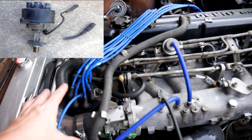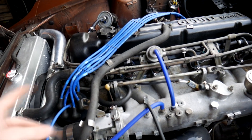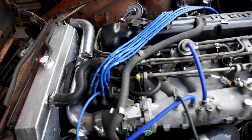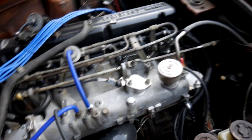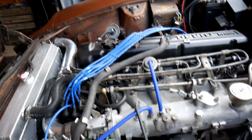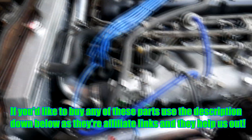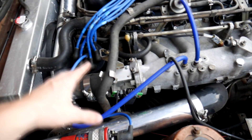The main things you're going to need: you have to have a turbo ZX distributor — a distributor that has a CAS installed on it — because the timing is actually kept on that. So you have to make sure you get a 280ZX turbo distributor. My L28ET is mostly stock; I'm running about 10 PSI of boost with a cheap manual boost controller that basically just tells the wastegate when to open. It's also intercooled — no stock J-pipe — just the stock T3 turbo going through an intercooler.